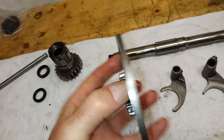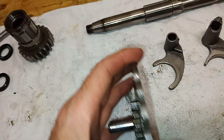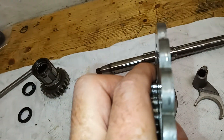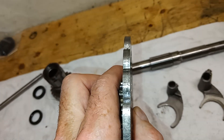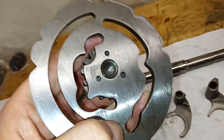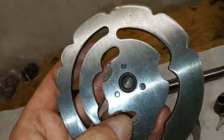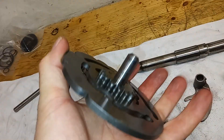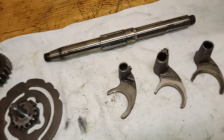I've checked the cam wheel — I've had problems with cam wheels before with excessive wear on the edge, but this one seems okay. The main place to look is around the first and second gear neutral area where things tend to wear, but it all looks fine. The grooves where the selector forks operate from look fine, the teeth on the cam plate all look fine, and it's flat — not warped at all.